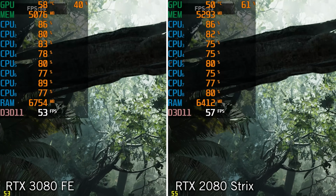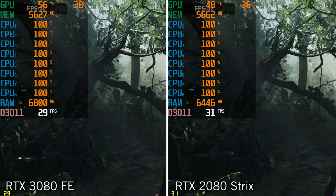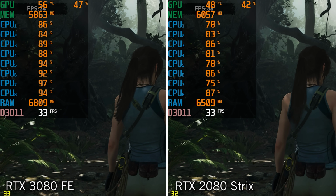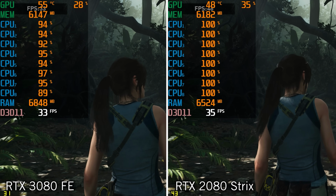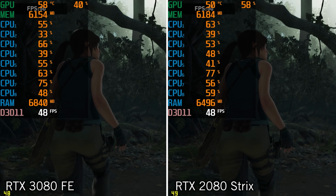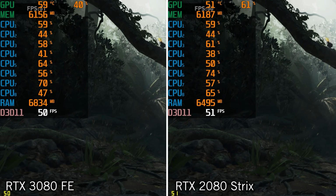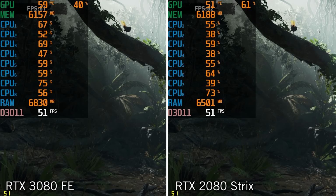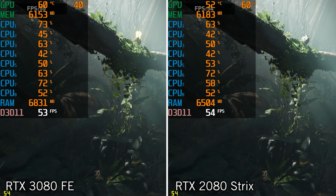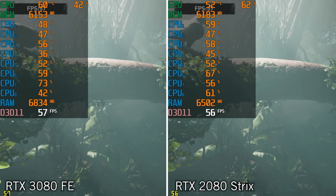Now, Shadow of the Tomb Raider is next, and the story is, it's just as dismal. CPU usage inconsistently pegs 100%, meaning the game doesn't even know how to take full advantage of this architecture. Technically speaking, since every 2 threads you're seeing here share resources, one could infer that if both halves add up to roughly 100% usage and GPU stats are way down, we're likely looking at an FPU or L2 cache bottleneck. Those are resources that are shared between 2 logical cores. The Achilles heel of the design to begin with is the FPU sharing and the cache sharing.